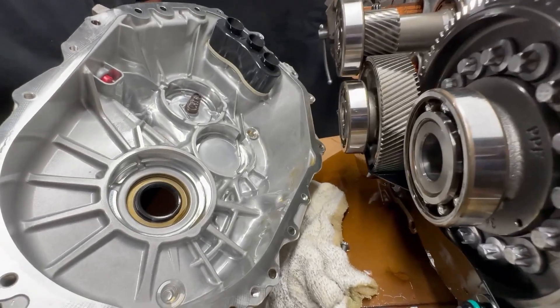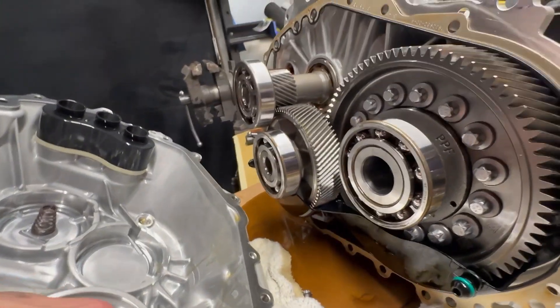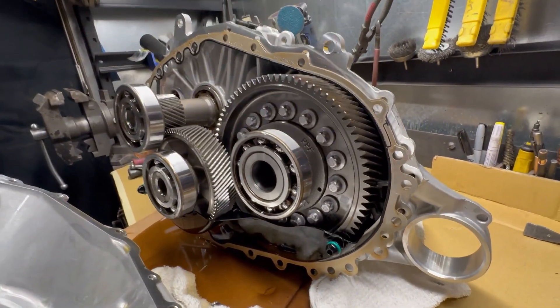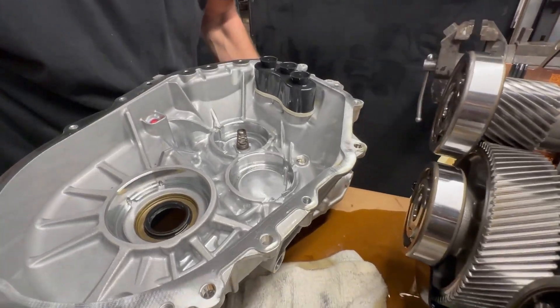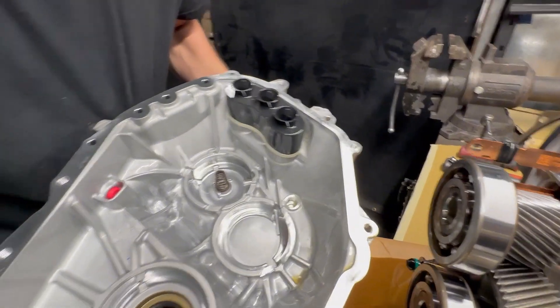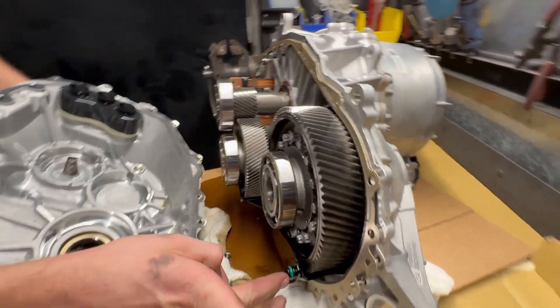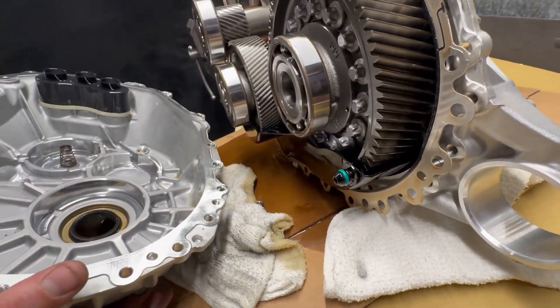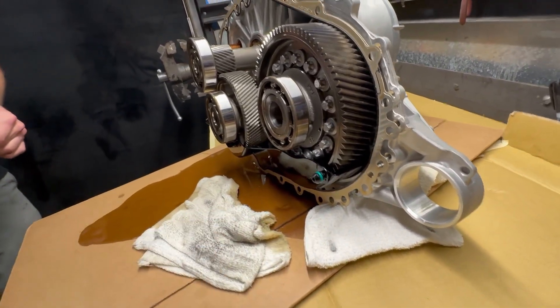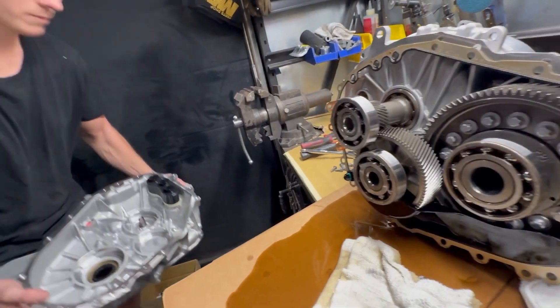Okay, so make sure that if there's any shims in there — is it stuck? Is it stuck to this side? Any shim? No. Anything else to note? It's pretty simple — all it's got is that spring, and then the three ports for the phase wires, that's it. I'm confused where this is — it looks like it's just locating it. It's just locating off of that hole and that hole, but there's no — well, that's just a piece of plastic, so the O-ring is just kind of giving it some resistance to vibration.